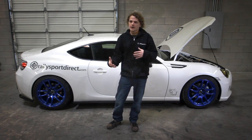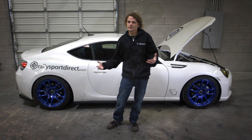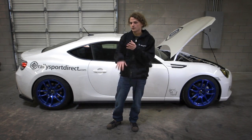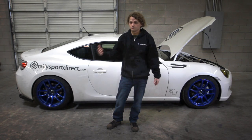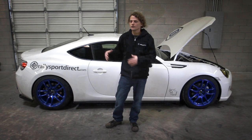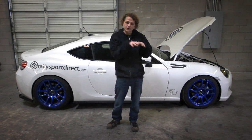If you're familiar with the car and you've dropped down that subframe before, you could probably do it in 45 minutes. They're really not bad, and they're just inserts. So you basically retain the factory bushing. You're not having to press anything out. You just slide them up in, put the bolts back in, and you're on your way. And that really did help the rear end of the car. With the suspension mods that we did, you could really feel that rear subframe flexing.